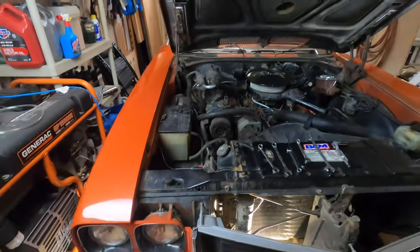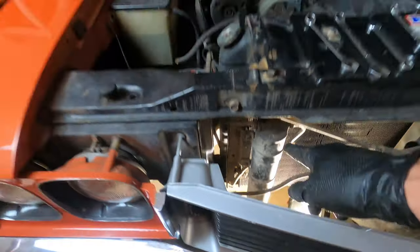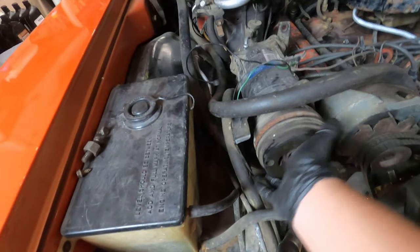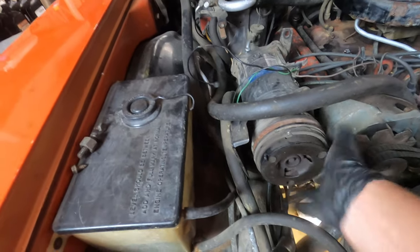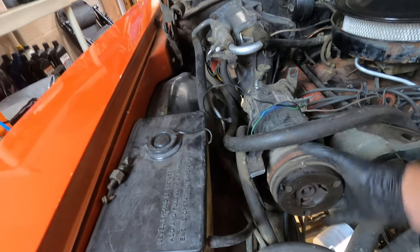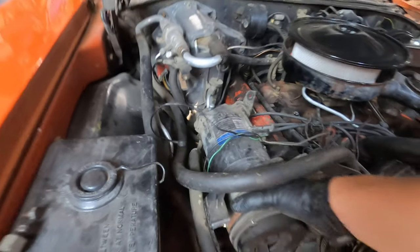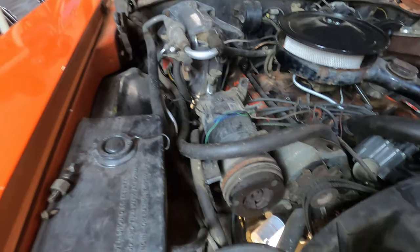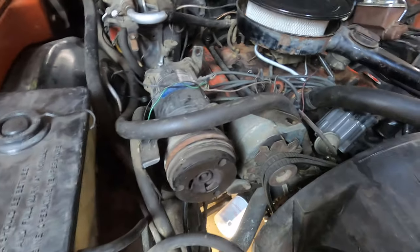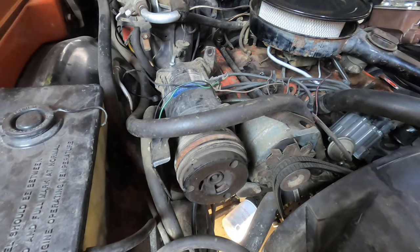Over here at the car, the dryer is right next to the condenser so that's getting removed. The old compressor is locked up — it's actually the belt side that's locked up. The compressor itself could still be good because the clutch moves, but the pulley itself doesn't move at all. There's no Freon in the system at all; there's a leak somewhere and the front seals on these do leak a little bit — they're self-lubricating.